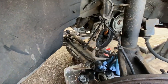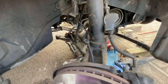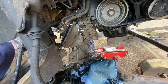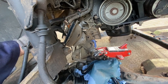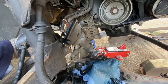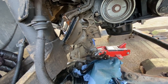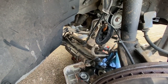What I found I needed to do was take the two drive shafts out next. Once I'd lowered the subframe enough that the wishbones dropped out of the bottom of the hubs, it made life fairly easy. I had a problem with the steering column linkage though - I couldn't lower my trolley jack far enough to get it under the sump, so I needed to bring it out towards the driver's side wheel arch. I'm going to drag the subframe out now, and then I think the next thing is to take the power transfer unit off.